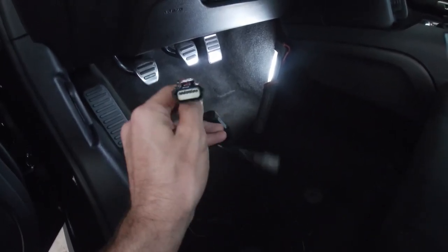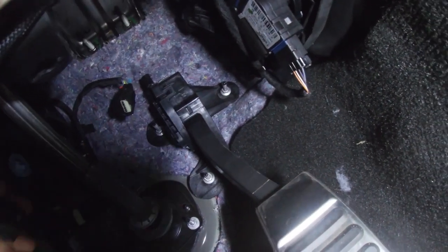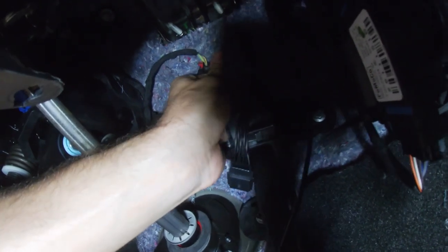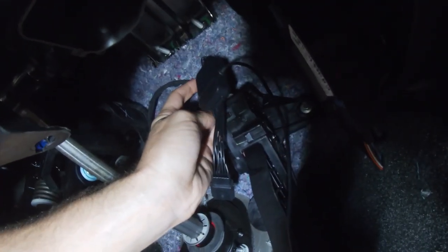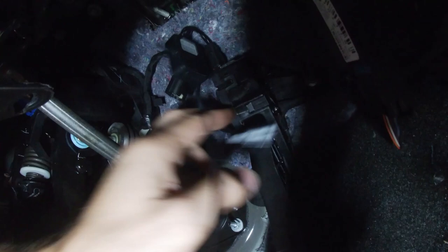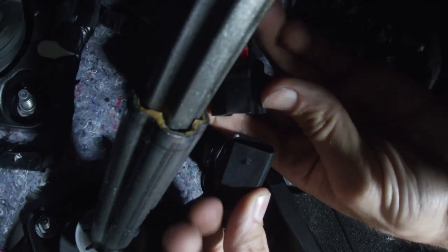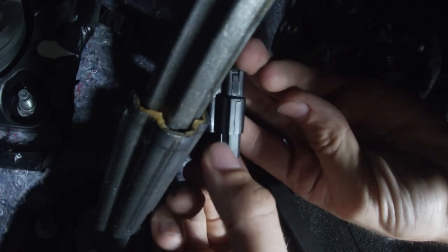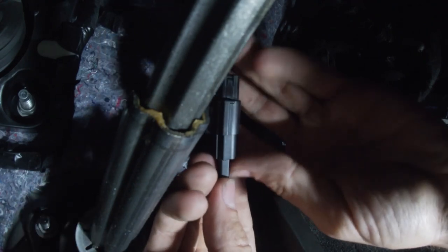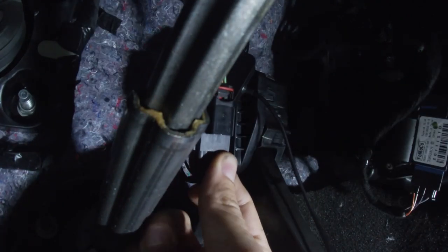We've got our Solar Performance throttle body piggyback connector. We're going to plug this end into the accelerator pedal and the male end into the OEM harness. Space constraints — going to try to show you everything we can. The end with the red locking tab goes on the accelerator pedal itself. It only goes on one way, so don't force it. Once you get it fully connected and hear it snap in place, go ahead and put the red locking tab down in the lock position. Then connect the male end to the OEM harness — this also only goes one way. Align the centering portion of the connector, fully seat it, snap it into place, and push the red locking tab down so it's flush with the connector.